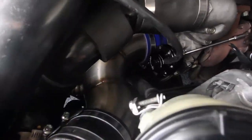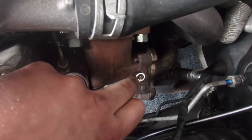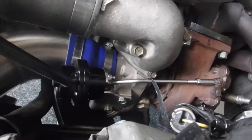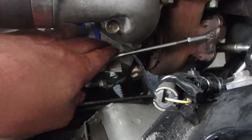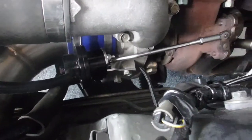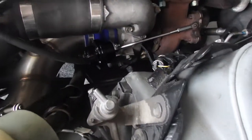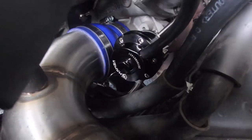We're back. I've got the new gate fitted and all plumbed into the vac lines. When you go to set this, you've got to set the preload at half a hole — where this eyelet is, sit half the rod in there and that's pretty much your preset. To get this to suit the OP6, I've bent this bracket out a little bit and it just keeps the rod away from the inlet housing. When you push the rod, we're all good — not touching at all. All I've got to do now is put the power steering wires back on and we are done.